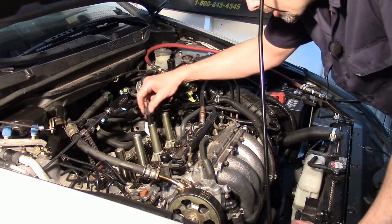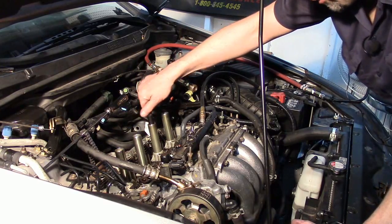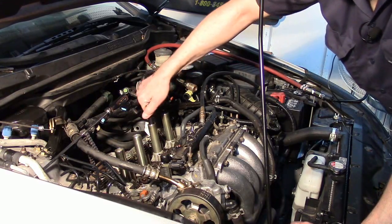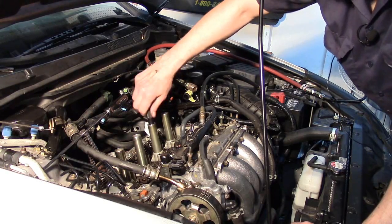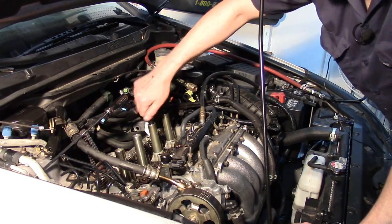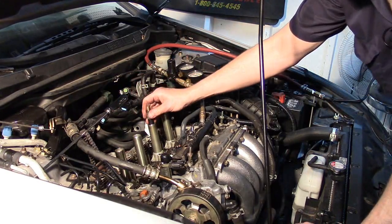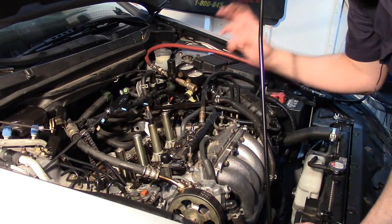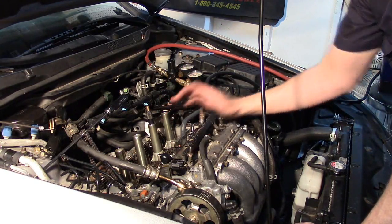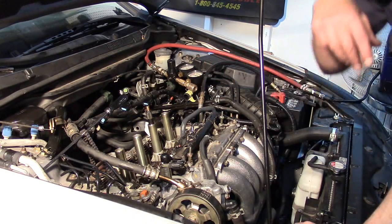The first thing I want to do is go to our known good cylinder and find true top dead center. It doesn't matter on compression stroke because we don't have a camshaft in here right now, so all of the valves are closed. But I'm suspecting with a low CFM output from the compressor, I want the piston at top dead center simply because it's less compressed air that the compressor is going to have to deliver — it should make it as easy as possible for this little guy to do his job.